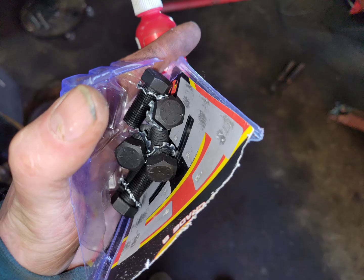Make sure you get new bolts for the pressure plate and the flywheel because they stretch when you torque them in. Alrighty guys, I hope you learned something. I think you've got it from here — you just reassemble it the opposite of how you took it all apart.